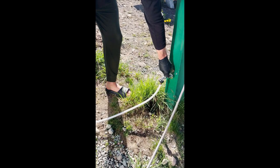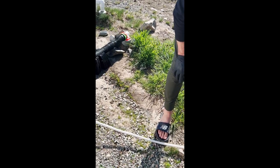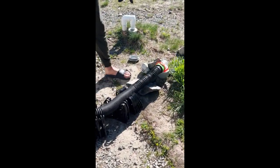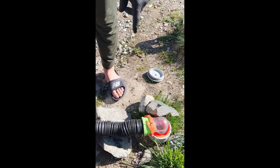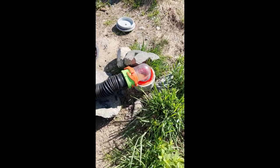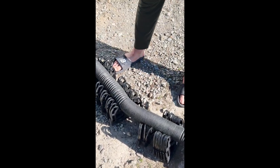Now our flush hose is hooked up to the trailer and to the water. We're just going to turn this on. You're going to go put your foot on the connection as well as you turn it on. You should start to hear the water going through the trailer. After a few seconds, you should start to see the water trickling out right there. It's not going to be a really fast flow, but I would recommend that you flush this for about five minutes at least. While it's flushing, look at the water color that's coming out and continue to flush until that water color is perfectly clear. While it's flushing, make sure that you are wiggling the hose a little bit and doing everything that you can to make sure that everything is coming out of that hose and the black water tank.